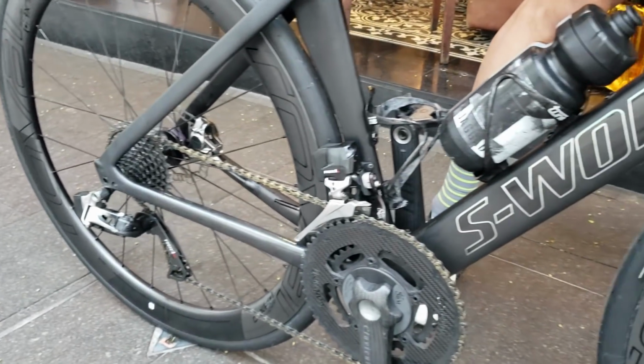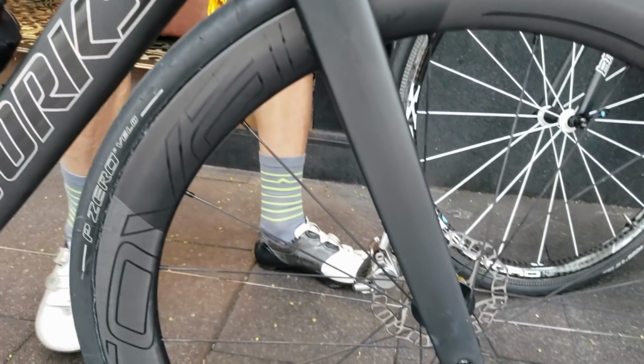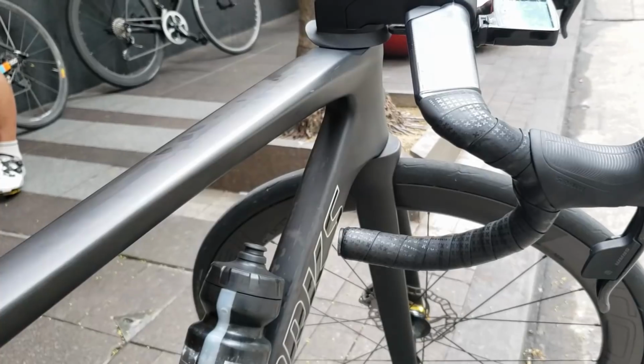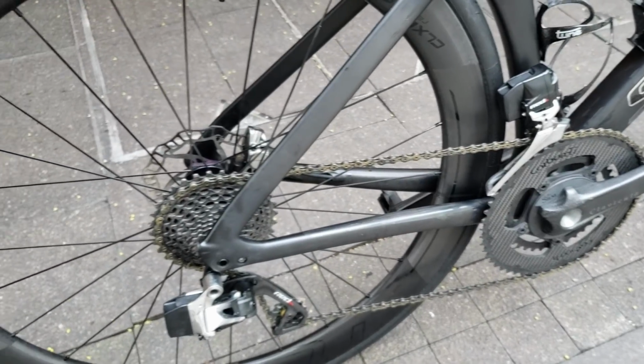I really don't see what's wrong with the Shimano standard. It's 86.5. It's one of the widest ones out there. Gives the bearings a good bearing stance, low bending moment on the bearings, which kills BB30, by the way. Your load application is quite away from the bearings, which creates quite a big bending moment.